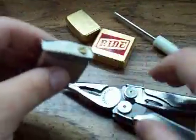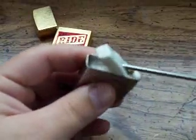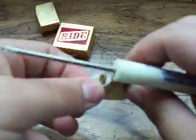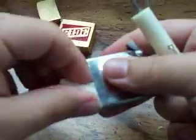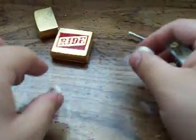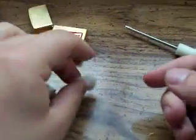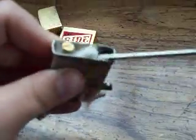So what you want to do is flip it over. Move the tools out of the way here. You can use something pointy just to get that felt pad out. Now it's not really necessary to remove the screw, because the hole will fit over the screw, but you may find that it's easier for you to do that. But it doesn't matter either way. So you take the felt pad off. Now technically you should have 5 rayon balls, which just appear to be cotton balls. That's what soaks up the fluid. Again, you're going to use your pointy tool to get in there.